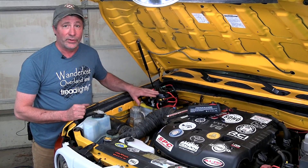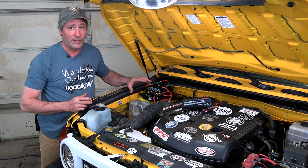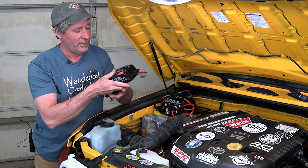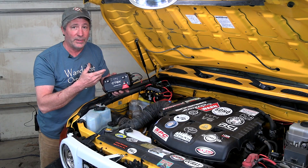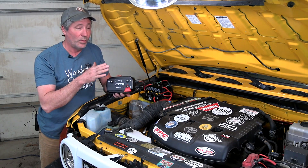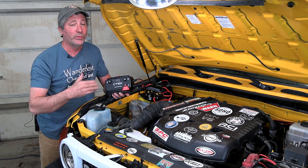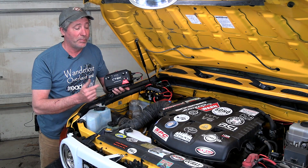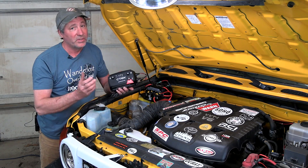If the service battery you're using is 100 amp hours or more, or you want to greatly reduce the time it takes to come up to a full charge, look into CTEK's SmartPass. The DC to DC charger pumps in 20 amps to charge the battery, but when you wire the SmartPass in with the charger, you get up to 140 amps going in to charge the battery. Note that it's required you use much larger gauge wire from the starter battery to power all this. Just a thought.